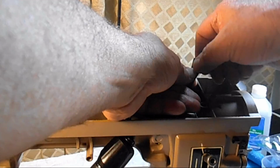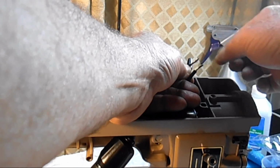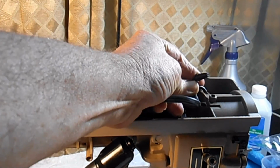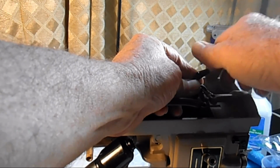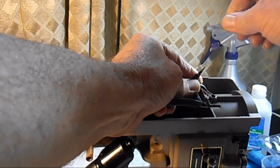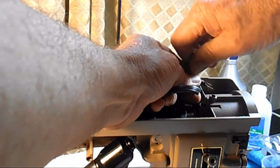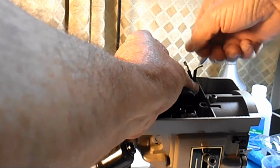And then you'll probably find the wires twisted together a little bit, so you can just keep turning them left and dress them out a little bit to even them out. And it's better to hold the wire as close as you can to the bottom of the wire nut, so that the wire itself doesn't twist much. And there's the other one, just like that. Just little black wire nuts. So I'll untwist those two leads. I want to save that wire because it's kind of short, I noticed, in the 301. They were a little more generous in the 4 and 500 series.